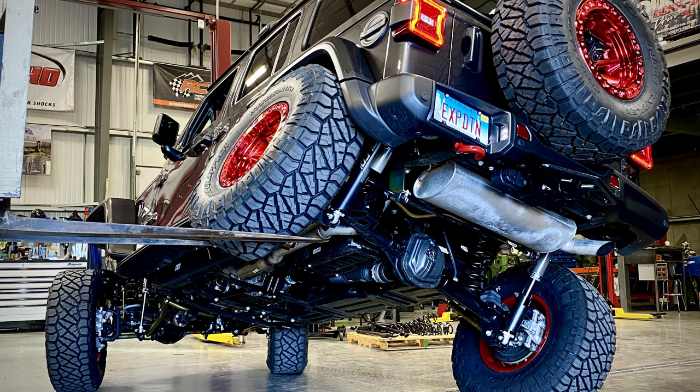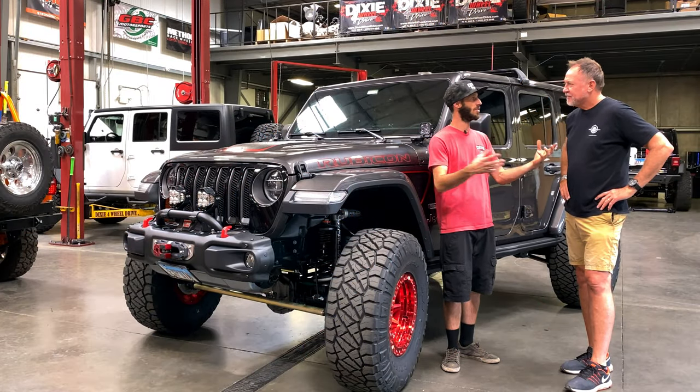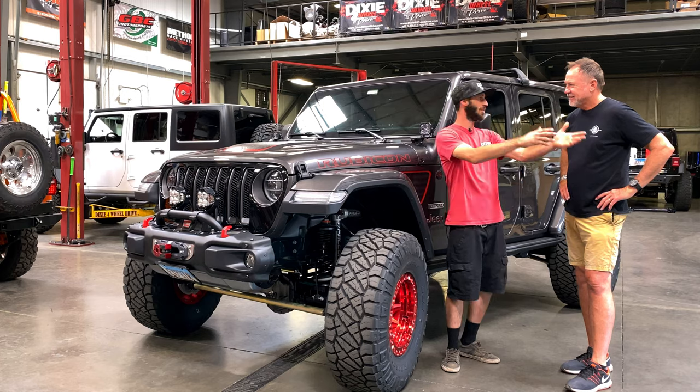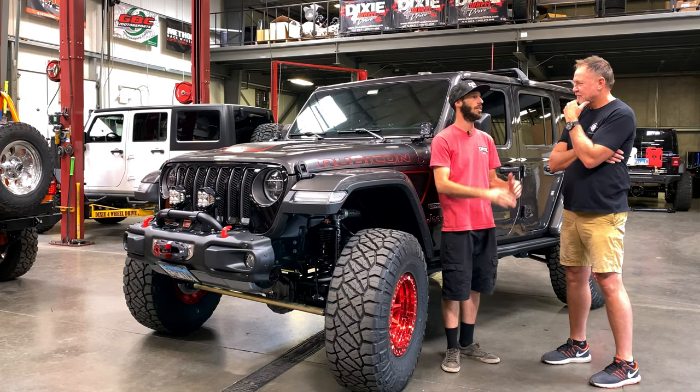Well, yeah, we set it up for bump stops with this size tire, running a Falcon shock versus a Metal Cloak suspension, tying that together. We also like to forklift flex it before we even go drive it, before we even hit the trail, to make sure everything's doing what it needs to do and your sway bar links aren't hitting into things, right.